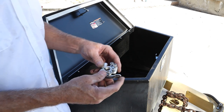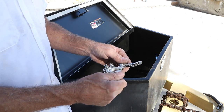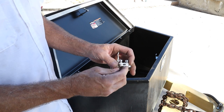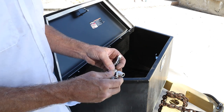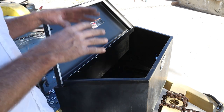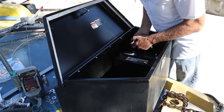We're going to mount the battery down inside here off to the side, and the idea is to mount the relay, circuit breaker, and stuff like that off to the other side, leaving as much space open on the other side for chains. I may put a divider in here to separate the chain area from the battery and winch controls. I also picked up these cool cam-lock terminals off Amazon. This is a top-post battery, and it comes with a negative and a positive cam lock, so he can pull the battery out fairly easily and charge it if he wants. It's just similar to a bicycle quick-release — you stick it over the terminal, clamp it down, and you're good to go. We're going to fit all the parts in before we start bolting stuff down.